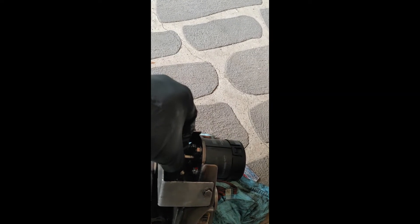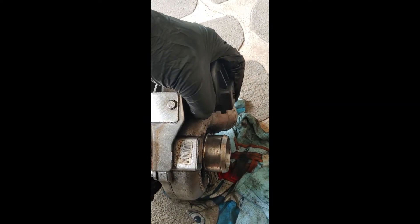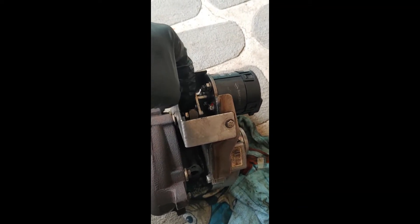You can also see that not only is it smooth, the linkage is also working properly with not too much play. Before removing the turbo, you may want to have a look at it while the connector is still attached to the engine. You can switch it on to see whether the actuator moves in and out — usually with the ignition on, it will cycle in and out to self-check before the car is even started.